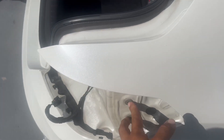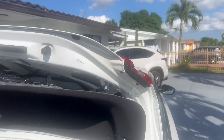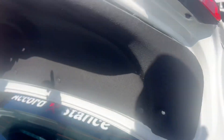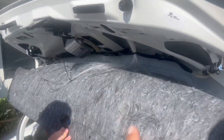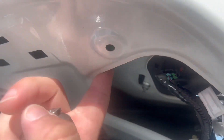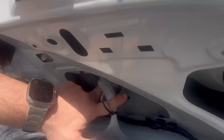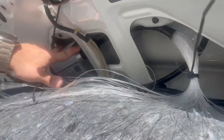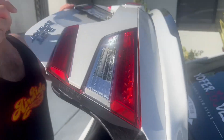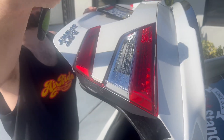There are little bolts that go in there. For the inner taillight — the one on the trunk — come over here and take this off. It's a bunch of little clips; you can just remove these corners, all the ones at the top and this corner here. You'll have easy access — it's like a flap. Then it's going to be four bolts: one here, one right here where my finger's at, two here, and then you have to remove two black bolts on this side so you can remove the top piece, which is a cover.